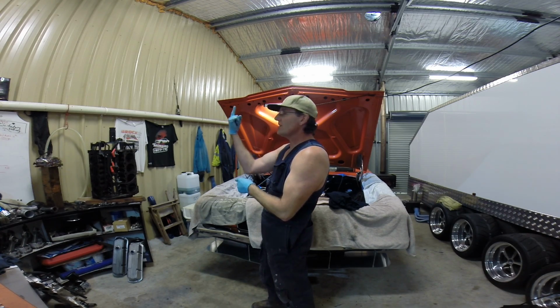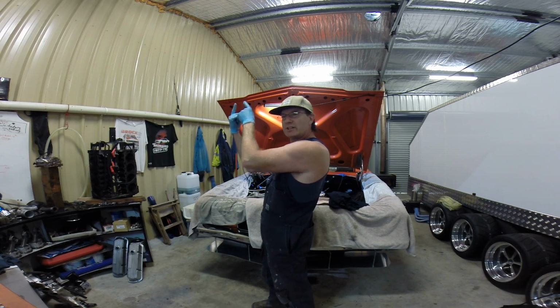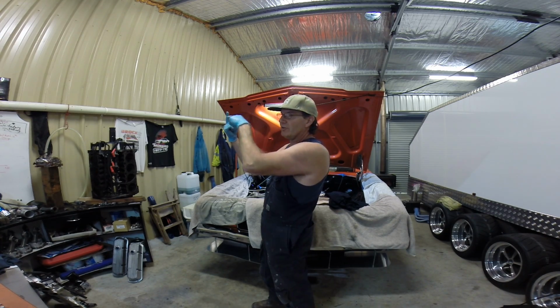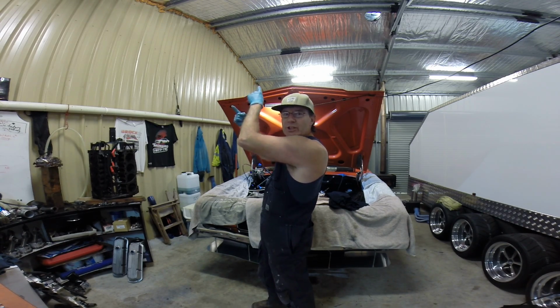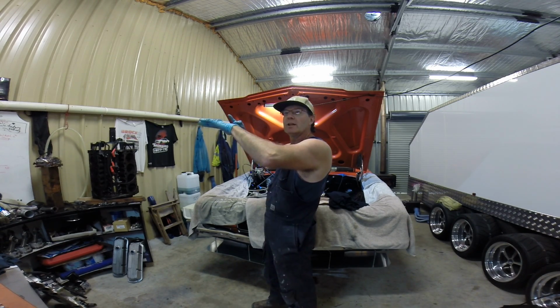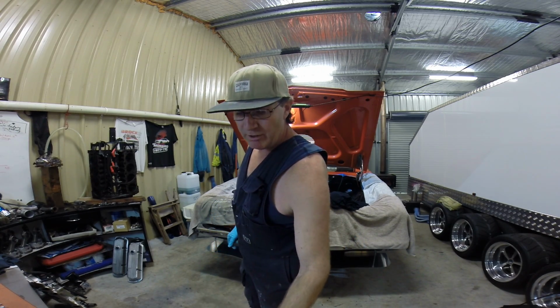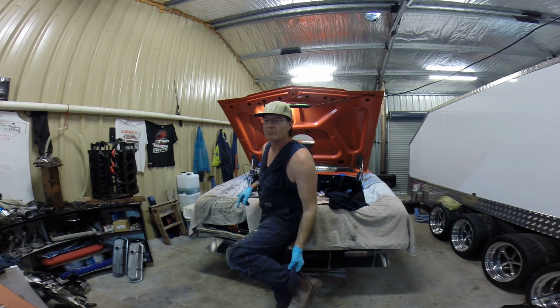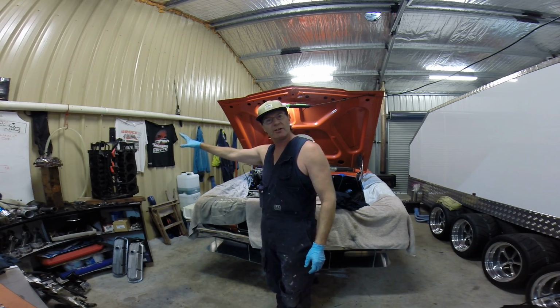Whereas originally it was 6 o'clock, and you've got a hole. So to me, yes, it's feeding the oil, but it's not creating a nice solid surface for the camshaft to run on. So by clocking it around a little bit, you still get incredible feed, but you're going to get that film of oil and plenty of bearing for it to run on. So we'll go into that. I think we're going 2 thou undersize on that one too, so we can lift our pressure up a little bit there, but I'll go into that, guys.